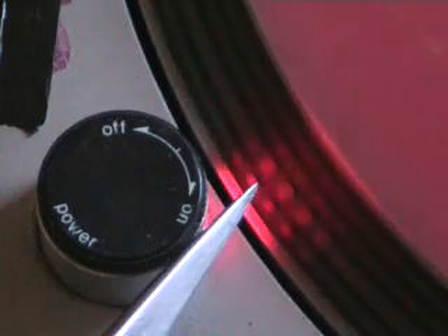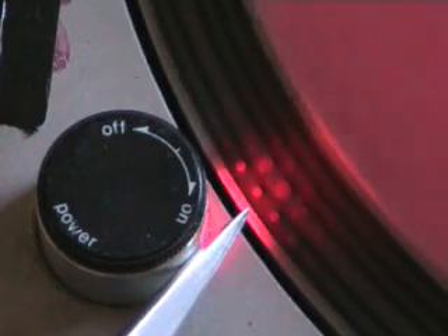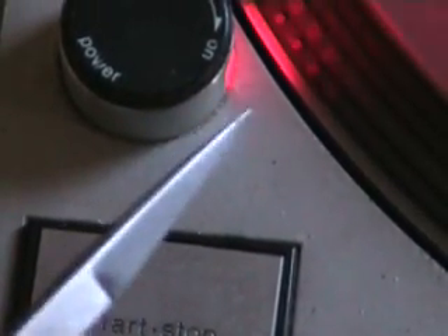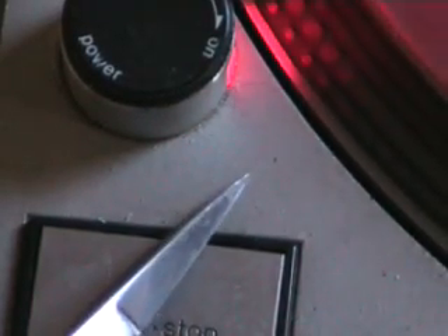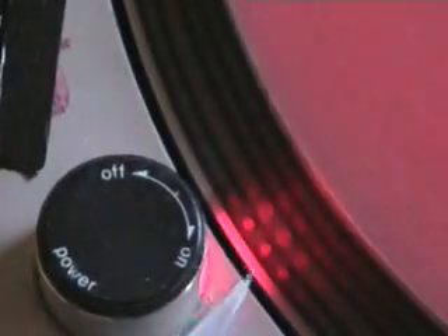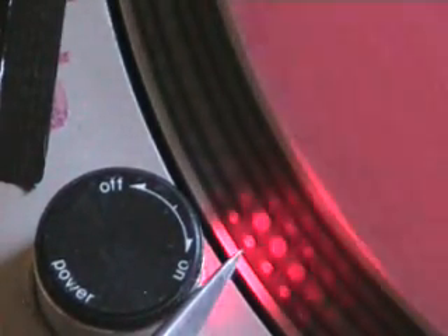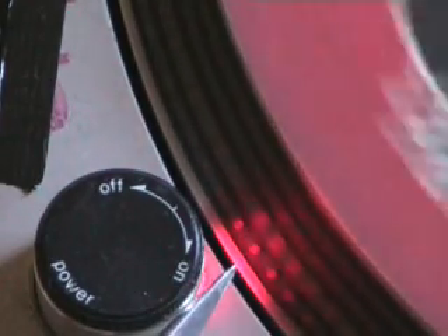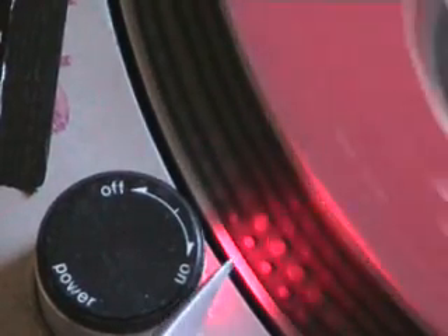As you reduce the speed, you can see the big dots moving, and then eventually you will see the small dots at the bottom stop moving. What you've normally got — I think it's around about here, this is an old deck — you've got a line with the big dot, then a small dot with 3, another one with 3 plus, and another one with 6 plus. I think it's roughly about minus 3, plus 3, and plus 6. Basically what it means is it's a rough estimate: when the actual dots underneath the big dots are staying still, that means you're roughly at minus 3% of the actual speed.